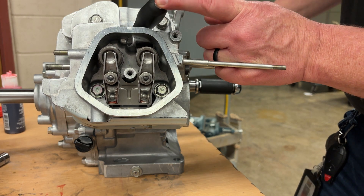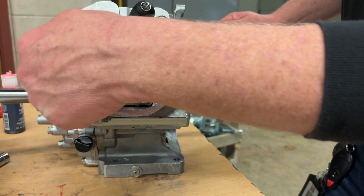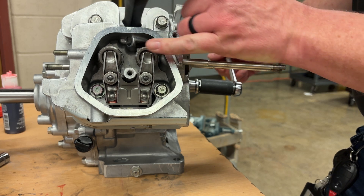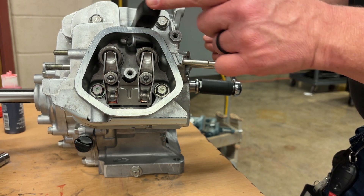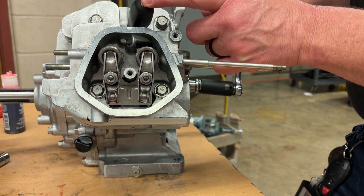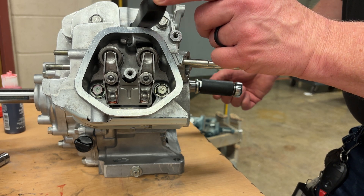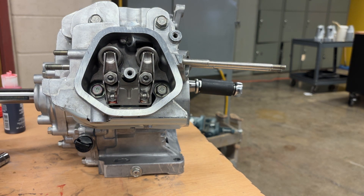I'll keep going around to show you what else is happening. Now I'm seeing the exhaust valve open — there's the muffler side. Here's where the carburetor goes on. There is top dead center. Right here both valves are moving — that's the intake stroke going down, opened up the intake valve, coming back up, both valves are closed, and that's all the way out. And that is top dead center of the compression stroke.